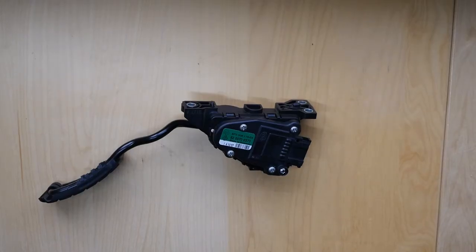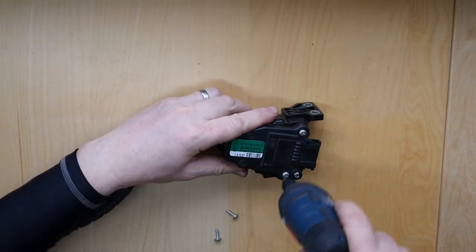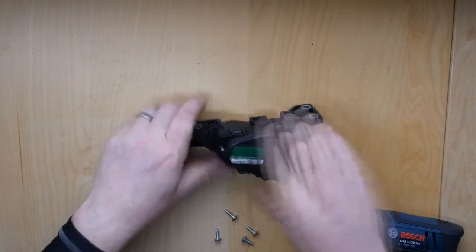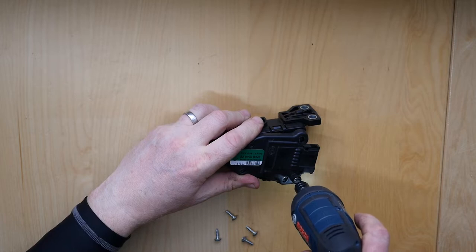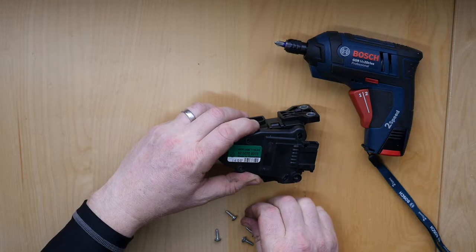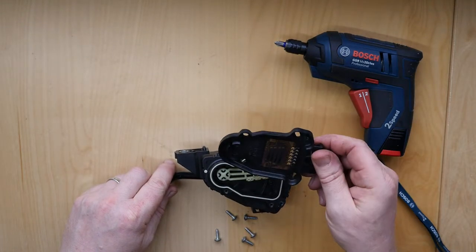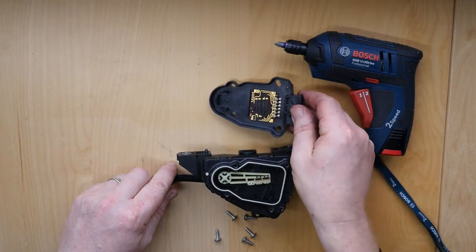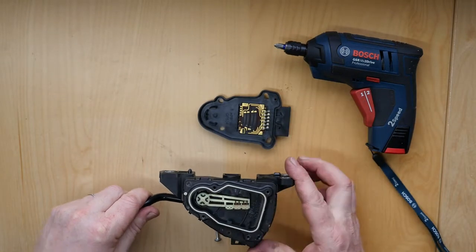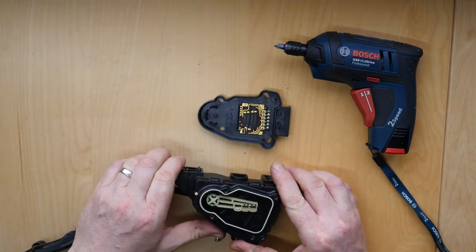Taking a closer look inside the old pedal. I'm going to open this out with my Bosch MX2 driver — that's five screws there. The connector part comes away and there are our little circuit boards, which the contacts appear to wipe along. So it's like a potentiometer.